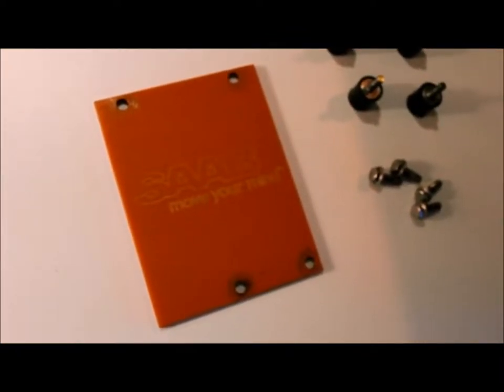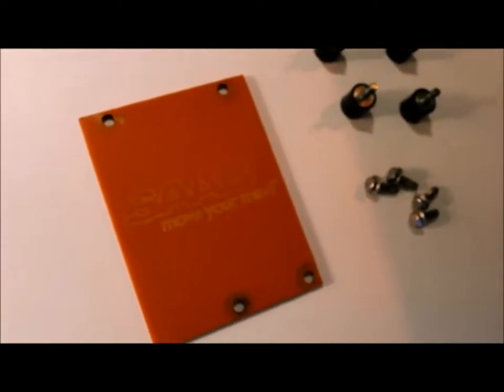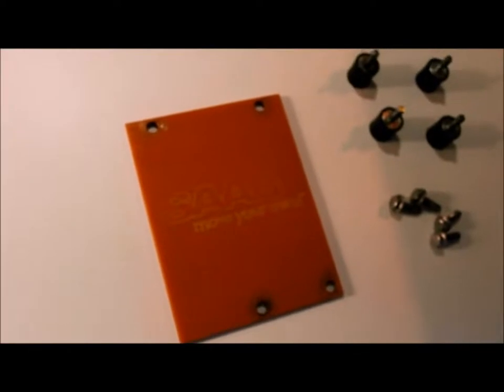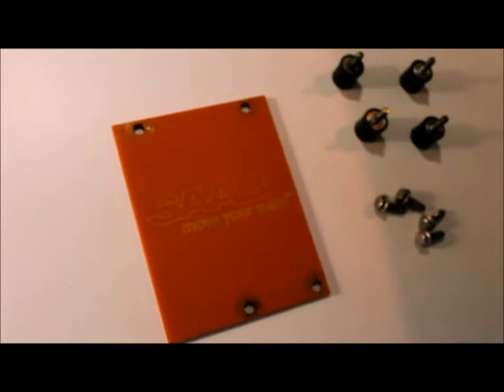I've been trying to fix this ECU problem because my ECU has been giving me issues. I'm at the stage of not knowing if it's fried or just needs to be kept from overheating. So I'm in the testing phase — the first step was to get a spacer for it, reset the code, drive it a couple of weeks, and see if the code comes back before getting the car inspected. But immediately after I put the spacer in, the car wouldn't start — stability failure.